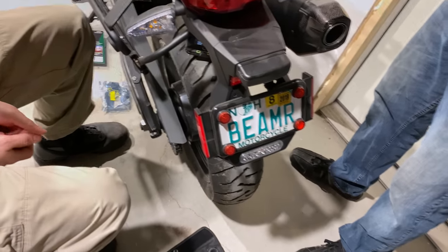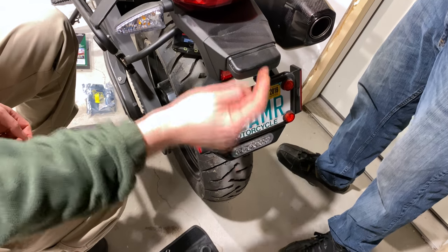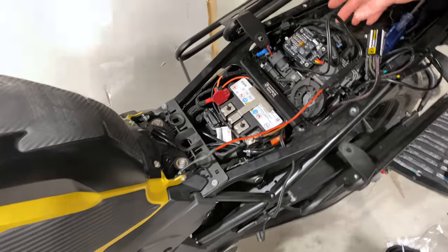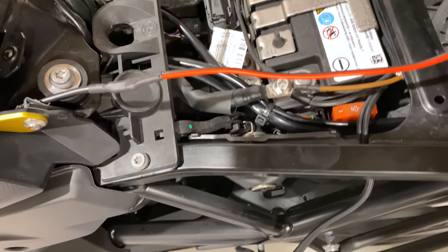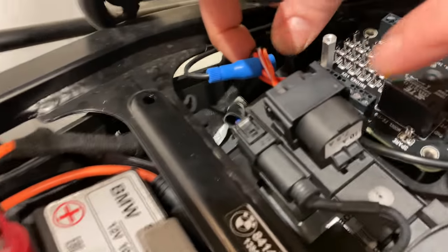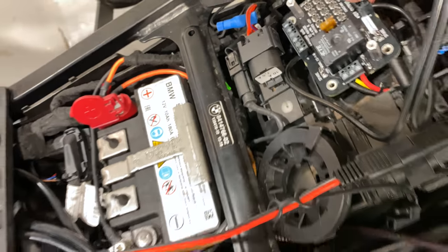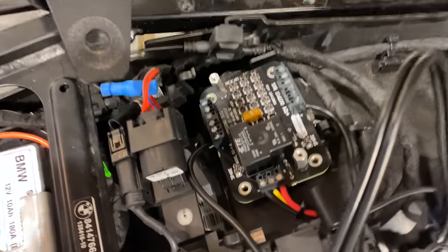So we went through this phase of trying to figure out where to get our trigger wire, and luckily we found it. This isn't documented anywhere. What I did was — on my GS the trigger wire comes out of this little fuse box right underneath the seat. We tried the same thing on this bike: we looked for the blue and red wire coming out of this little fuse panel, same one as my GS, tapped into it, and lo and behold it worked.